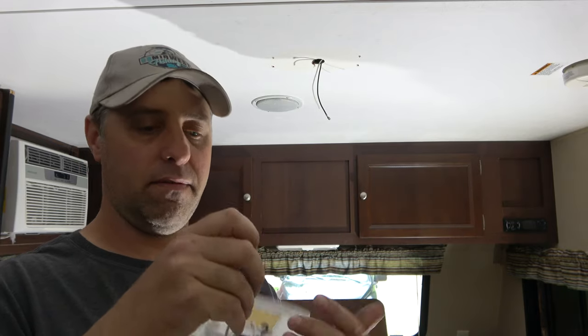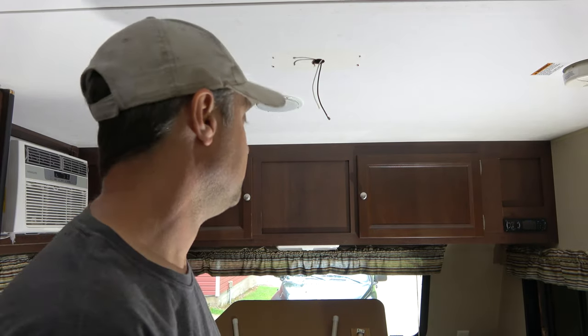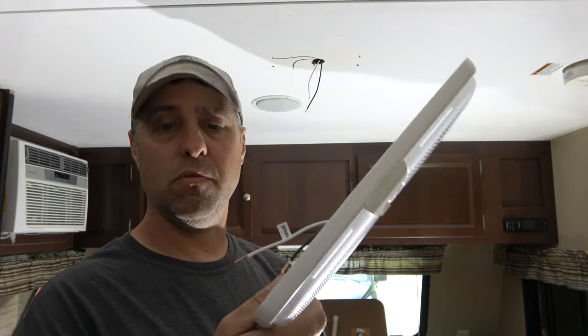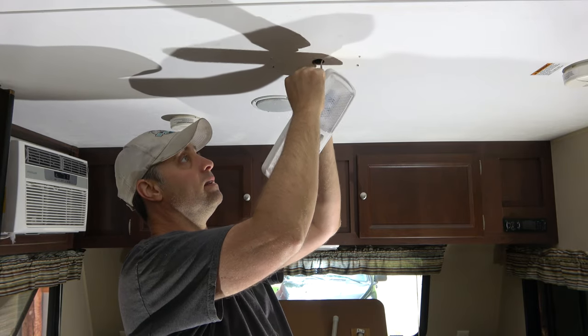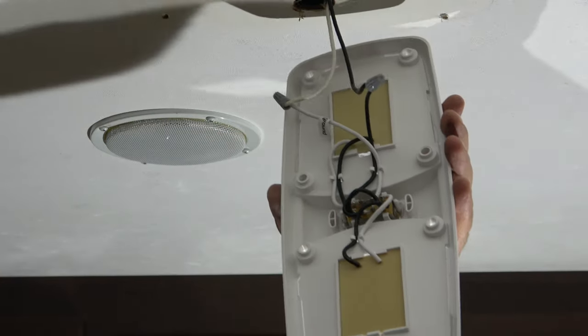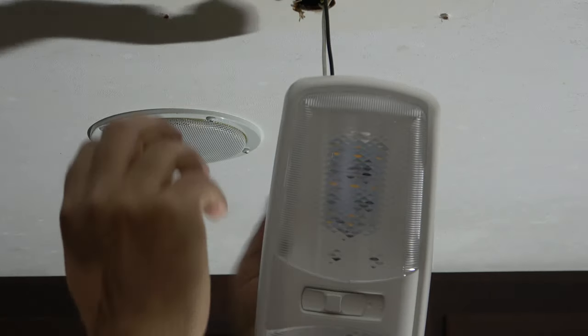Just pull these little sleeves off and that leaves the bare wire exposed. Now we just got to strip the wires there and put a wire nut on them. These lights are polarity sensitive, so if they don't work you got it wrong — just switch the wires around and it should work just fine. Go ahead and hook them up with the old wire nut. That's all there is to it. Now I'll just take some tape wrapped around there just to make sure the wire nuts stay on and stay protected.